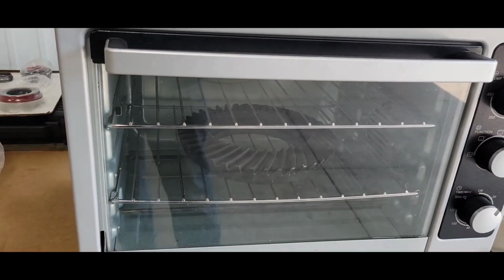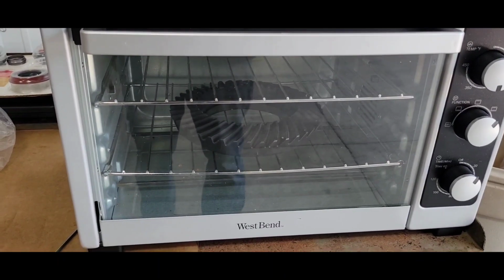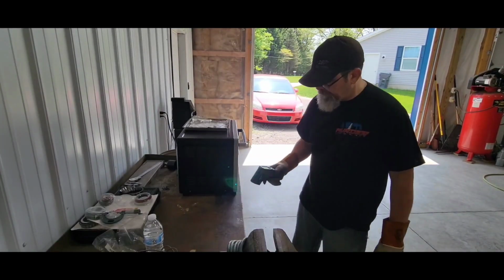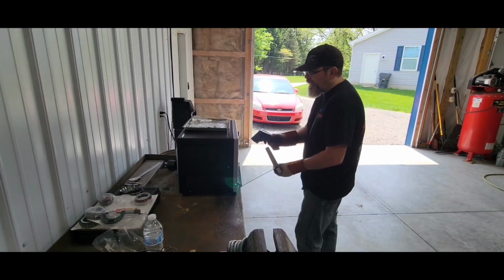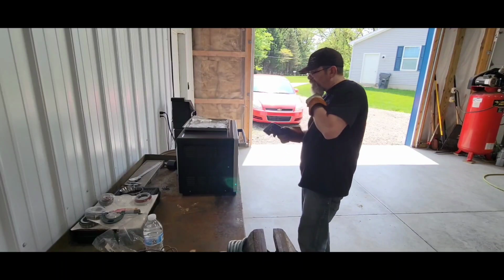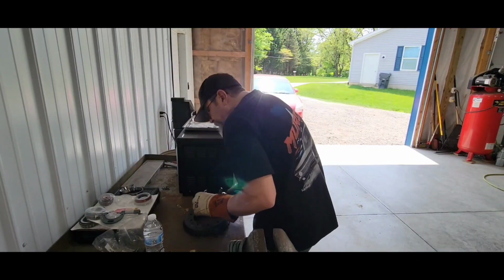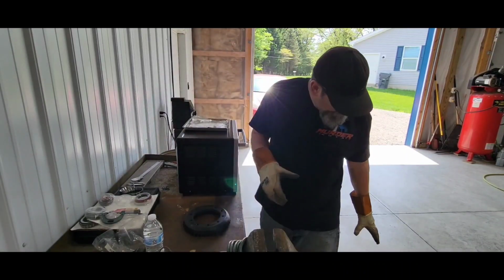Gonna get her warmed up. It's really tight, and it doesn't measure like it's really tight, but it's not going on. So put a little heat to it. Got the differential in the freezer, and hopefully that thing drops right on. Get the bolts lined up, and get her in. Oh, 300 Fahrenheit. Size does matter. It really does. Got 4 thousandths growth. I'm going for it.